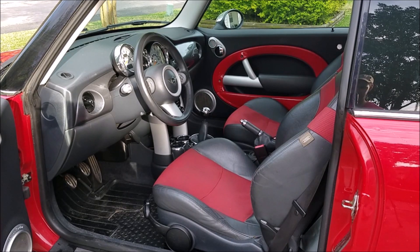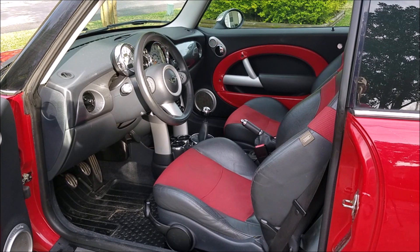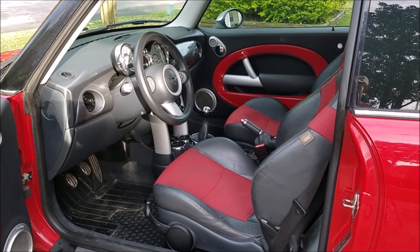One more interior upgrade: we're going to be adding about 50 pounds of sound deadening to this car. If you've ever been in a Mini or read about them, you know they have squeaks and rattles and they're not exactly the quietest cars — especially coming from the E39, the difference in interior refinement is huge. Since this is mostly a street car rather than a race car like the active 350Z, adding a little weight for a much more refined interior is definitely worth it. We're putting sound deadening in both doors, under the back seat, on the rear wheel wells, the tailgate, the trunk, and up against the firewall — all I want to hear is the exhaust note, the supercharger whine, and the radio.